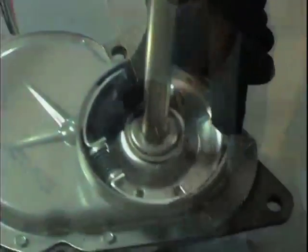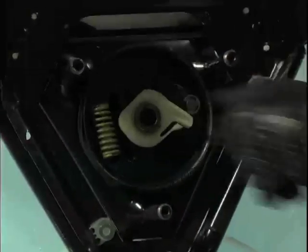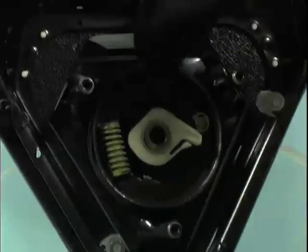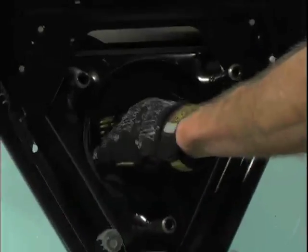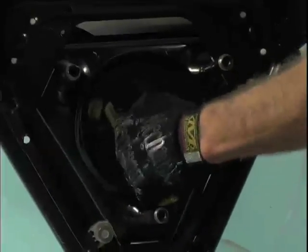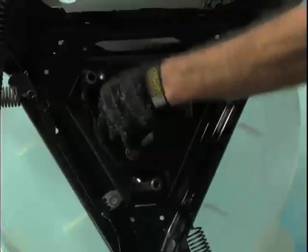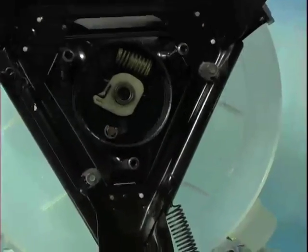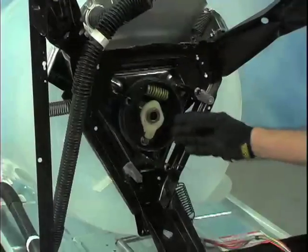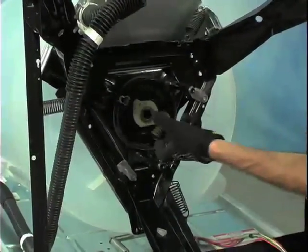This is the clutch — we'll look more closely at that in a moment. Next we will look at the brake and drive tube. The brake will release from the side walls if it is rotating counterclockwise, which is the direction for spin. When the drive is moving clockwise for the agitation stroke, the disc will expand, holding the inner tub from movement. To remove the drive tube, grasp the brake assembly and pull while rotating counterclockwise to release the pads from the side wall.